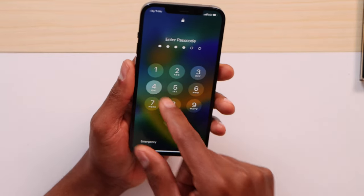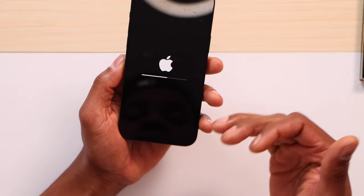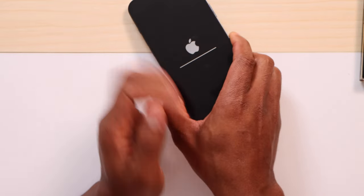Before you reset, let me explain something. When you reset your phone's network settings, it will reset all wireless connections — including Bluetooth, Wi-Fi, and data connections. You will have to reconnect your iPhone to your Wi-Fi network by finding it and typing the password again. You'll also have to reconnect all your Bluetooth devices. It's a really good solution to fix any wireless connection issue. If you decide to do it, just type in your passcode and confirm Reset Network Settings — your phone will restart automatically.